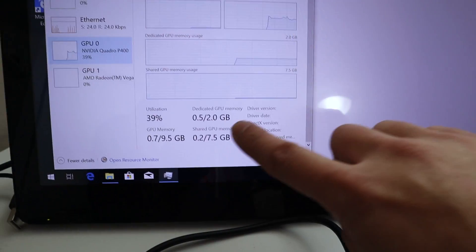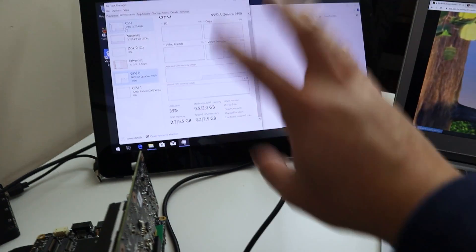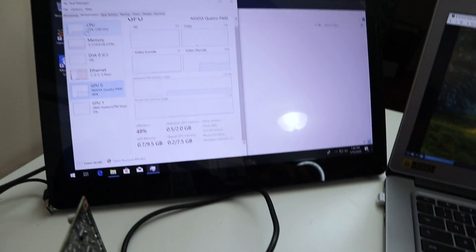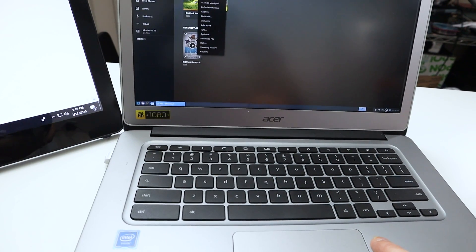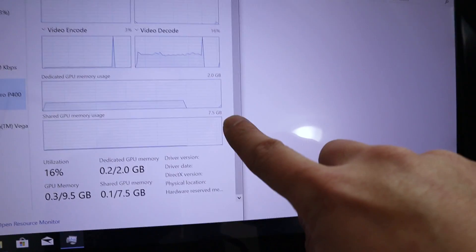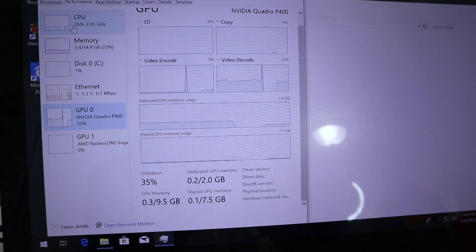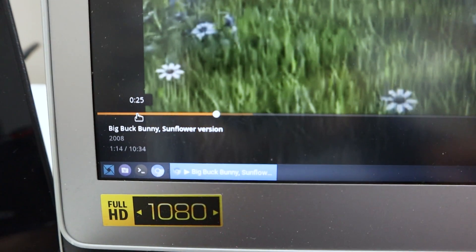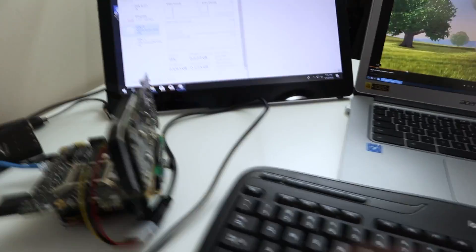This is a 4K to 720p stream, and it's only using about half a gigabyte of the 2GB of RAM. So this graphic card can actually support up to four concurrent streams without much issue — especially if you unlock it with the patched drivers. Now if I encode from 1080p media, it's very impressive. With 1080p, I'm barely using 200 megabytes of GPU RAM, it's less intense, and the streams load so much quicker. If I skim forward, look at that transcoding bar grow so fast. The transcoding is really fast with this card on 1080p, but it's also able to do 4K.